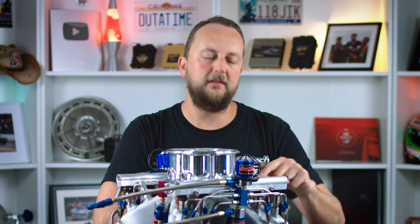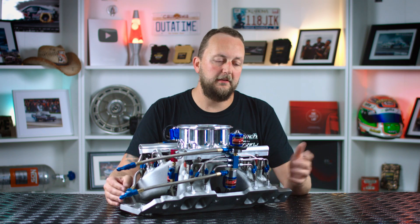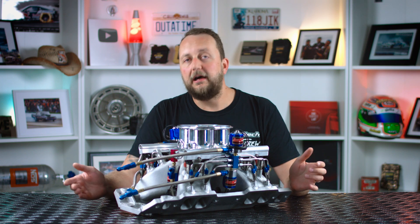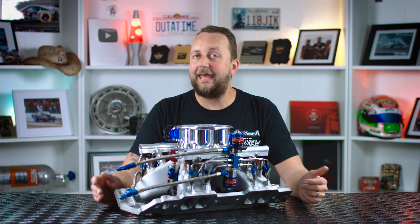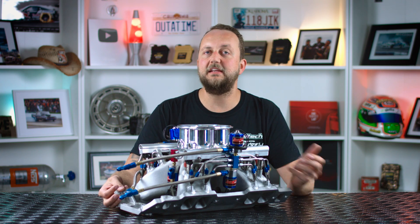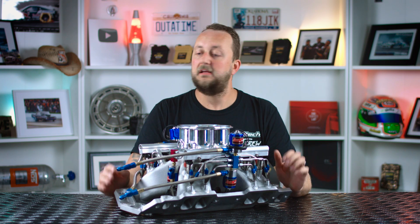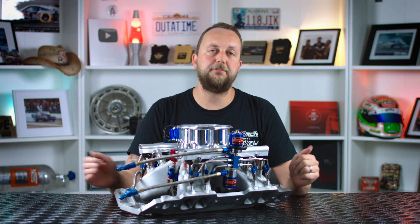If it's a dry system, we can do individual cylinder trimming by adjusting how much fuel goes through each fuel injector. It goes without saying that if you're going to add two 400 horsepower kits to your engine, stock internal components aren't going to cut it. If you're adding around 100 to 150 horsepower kits, most factory engines can handle something like that. But things like stronger connecting rods, forged pistons, upgraded head studs, head gaskets — exactly the same rules as if you were supercharging or turbocharging the engine. You would need to build it to the horsepower that you're going to be making.